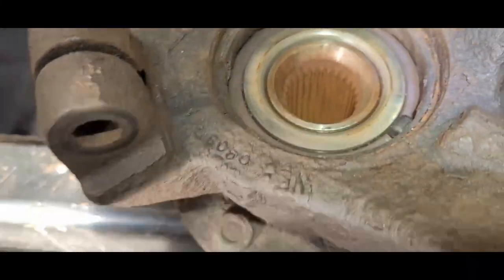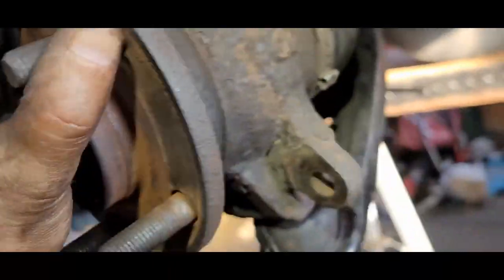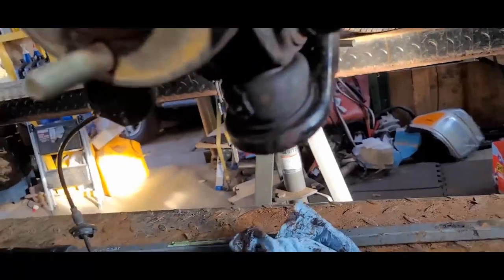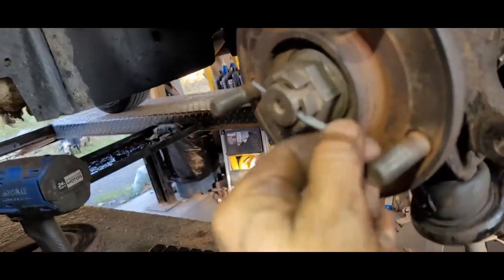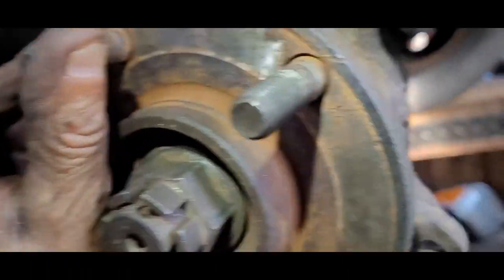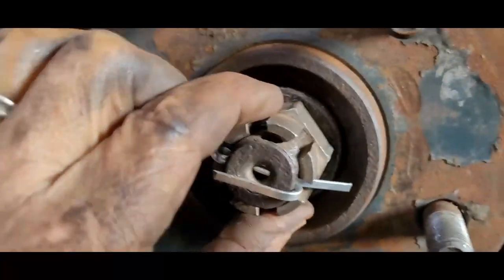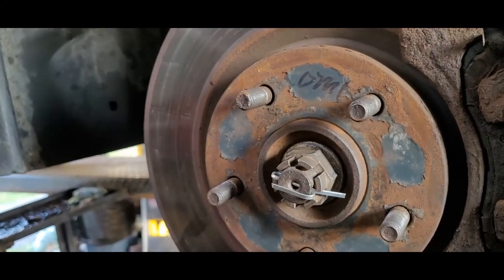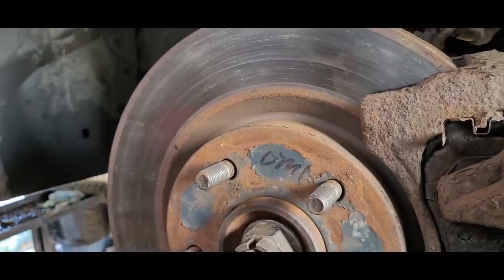So there we are. Hopefully that takes care of everything, including my anti-skid. Okay, torqued her down to 180, where she needs to be. I think I got just a little bit of room to put one through, which is where she should be. And of course it's nice and loose. All right, she's all back together again. All retorqued, all re-keyed. It's nice and loose. That is at 180 foot-pounds like it's supposed to be. And of course it wasn't picking up the anti-skid when I checked it earlier because it was too far away for the pickup. So hopefully we got it this time.